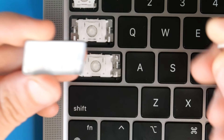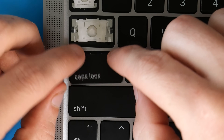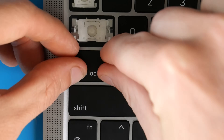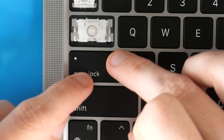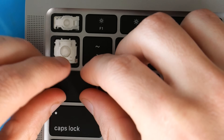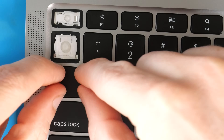For Caps Lock, there's just one support bar — it goes on the bottom of the key. Slide it underneath the little aluminum hooks in the center of the slot, pull the key towards you, push down on the top, then push away from you to lock the awning clips into place. Press down on the bottom to lock the lobster clips — Caps Lock reinstalled. For the Tab key, attach the bottom support bar, slide it underneath the two aluminum hooks, drop it down, pull it towards you, push away from you to get it under the awning clips, then press down on the bottom to click it into place.